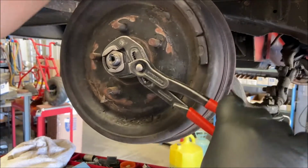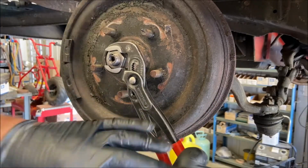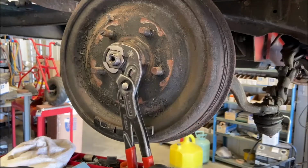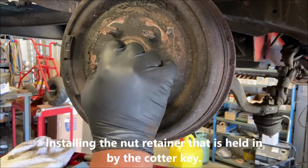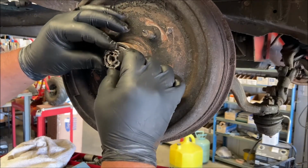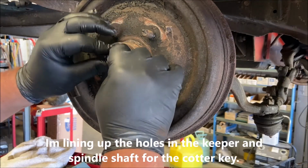See, there it's loose. Nut stops, loose. Stops right there. I'm not putting any pressure on this. Okay, I'm just very lightly doing it. Stops, preload, right there. I hardly turned it at all. Now it's got a preload on it. That's where you want it. A slight preload. Don't forget to put the cotter key in. If I can find the right one. Okay.